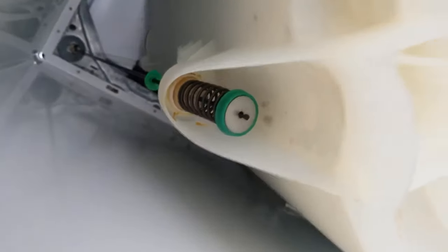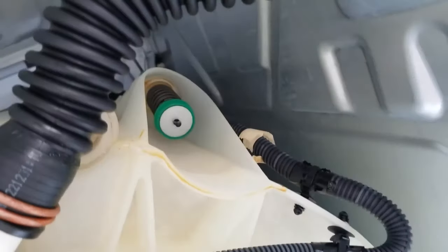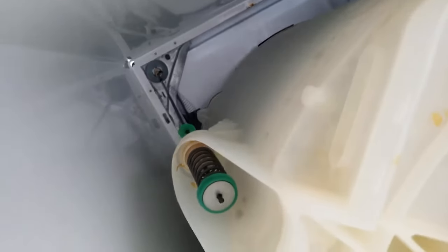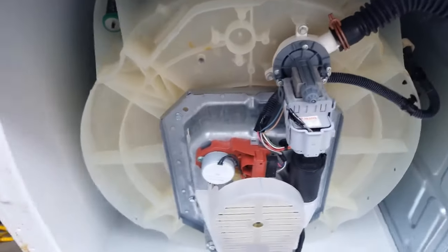Inside of it, you've got rods in each corner. Let me flip it upside down and show you what I'm talking about. Now look inside this washer — you have a rod that's hanging that tub down to a spring. It goes all the way up and comes down to here. This whole thing is built this way, and it's a terrible philosophy when it comes to balancing out a load. You would never see this in a commercial application. Over time, unbalanced loads are going to destroy this machine — it will shorten the life of it, can damage the floor, damage the washer itself, and cost you more in service calls.